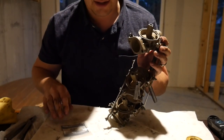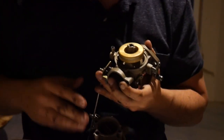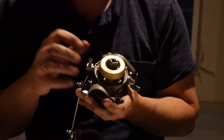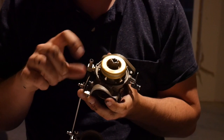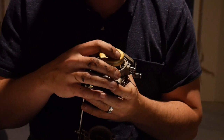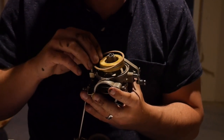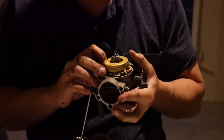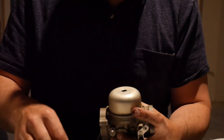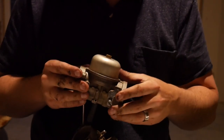Now that all three seats are swapped out — I actually had to refer back to the photo of the spring I took, because even though it felt like I got it in there right, I noticed it wasn't contacting well. So I had to flip it upside down and now it's in there correctly — it's still spongy, which is good, and it should be set up correctly. Now I'm going to replace this piece around this lip here, press the cork seal into place, and screw the bolt back on. Alright, one down, let's do the other two.